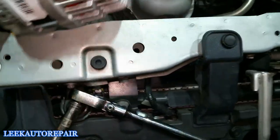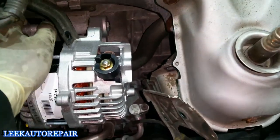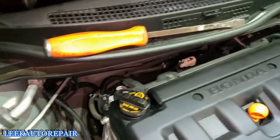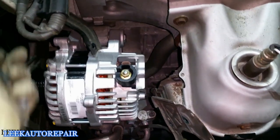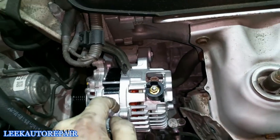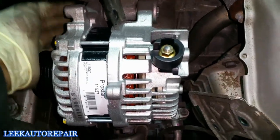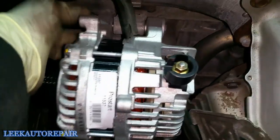Going back in right now. Mind you, I'm doing this whole job with one hand — some people would be struggling with two hands. Now I've got it in. First thing I'm going to do is grab the long bolt and line it up — mount it properly. Put the top bolt in first before you put the second one in. Got the bolt started. It might be a pain to get in because this whole assembly has a lot of play — so while you're putting the bolt in, wiggle the alternator around while threading it at the same time and you should have success.